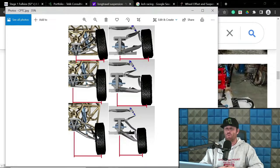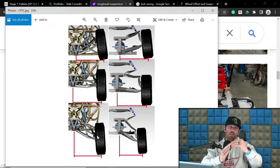Now, if you're a rear-wheel drive setup, you can definitely allow it to go negative camber at extension as well. That you want to avoid in the all-wheel drive stuff, like I was saying, even for the long travel kits, because if you start infringing on negative at extension, you're just decreasing wheel travel intentionally, because you're now getting to the maximum angle of the CV usage quicker.